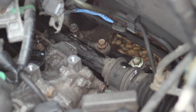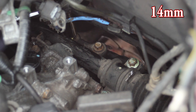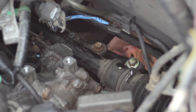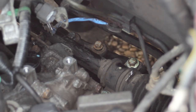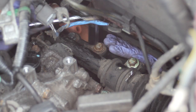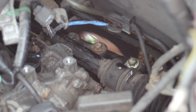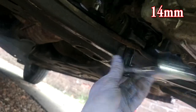And then there's the gearbox mount. As I mentioned before, inspect your mounts whilst you have them off the car - it's as good a time as any to take them off and replace the bushings. You can see from the angles I was working at here this can be a bit of a pain, but luckily with the right selection of sockets you can get it done. With that the subframe is reconnected and all done up. Remember to go around and give everything its final tighten - it might be worth it after it's been driven just to make sure any vibrations have settled and everything's okay.